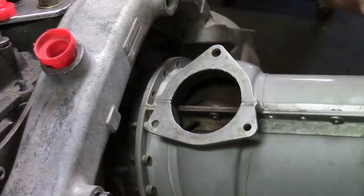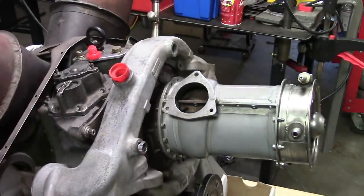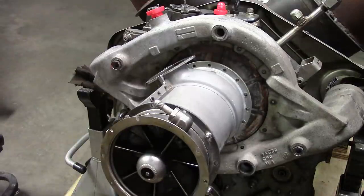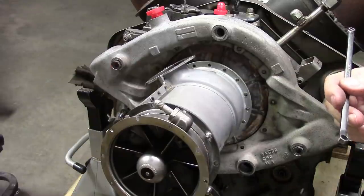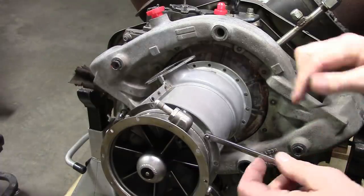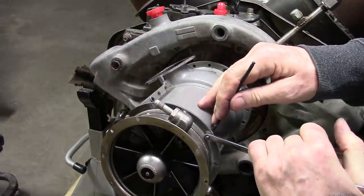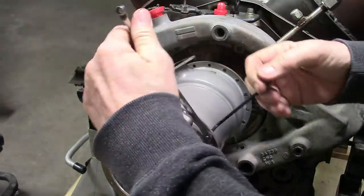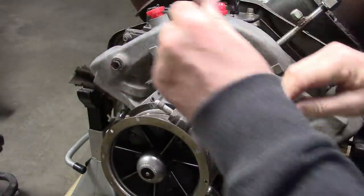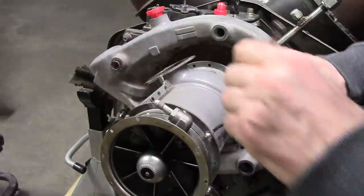I'm going to get that nut without dropping it — very good. Goes into the parts box labeled 'rear' — this is the rear horizontal — and 'front.' So are we looking at the last of the front bolts? Let's see — I'm going to move the camera. You can see the last one now. This one I haven't relieved of its torque, so it's fully on there. 7/32", super tiny. We just want to hold this and move the wrench — it feels like about 60 inch-pounds, which is probably maximum for these fasteners.